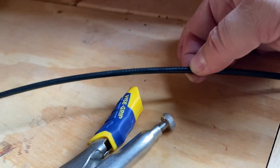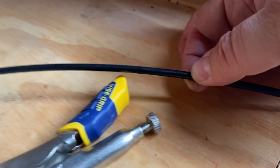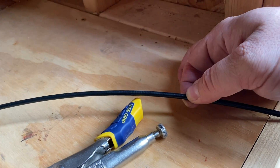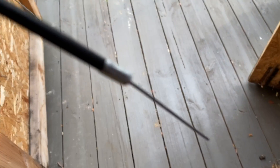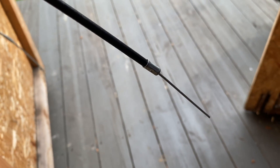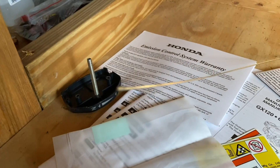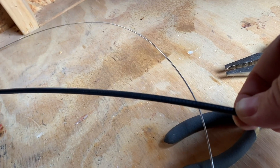I've got my fingers here at the length where I need the cable sheath to terminate, so I'm going to trim the cable. You can't just start trimming away because you've got this inside piece that moves back and forth with the cable, so you've got to pull that out. I removed mine entirely — I just pulled it out of the sheath. Now I know where to make my cut right here, so I can cut this nicely.